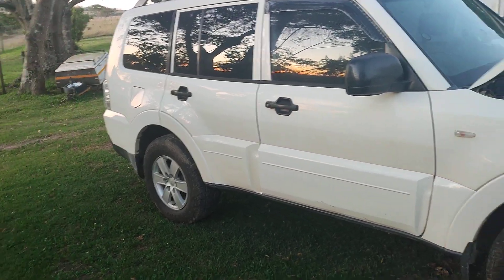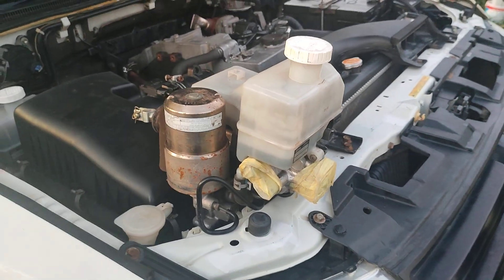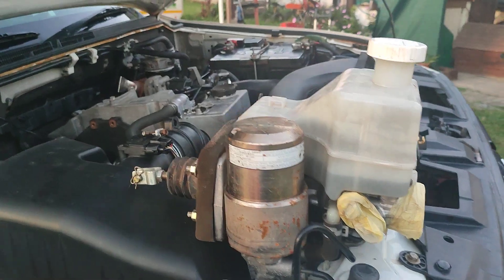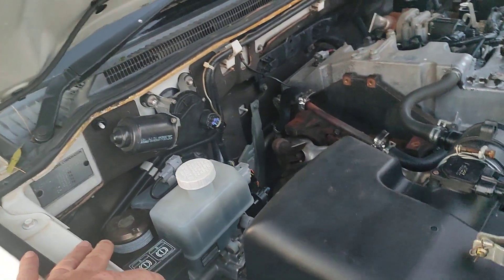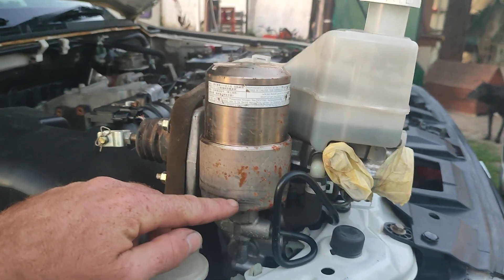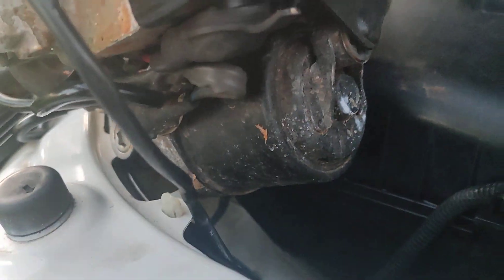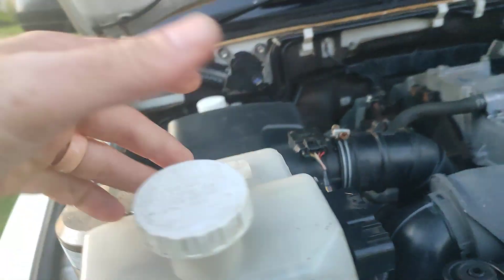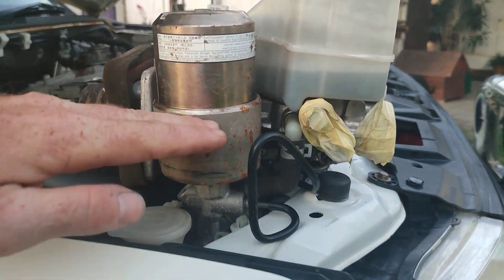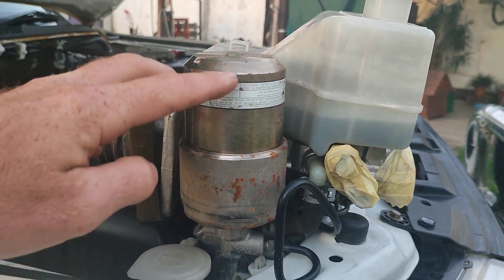With a failure of the ABS units there are quite a few failures, but generally it's the hydraulic brake booster that fails. I've got the spare here — this is the one that failed — and I've put a second-hand unit in which is working. Basically, at the bottom there's an electric motor that pumps brake fluid from the reservoir into the accumulator, starting from a piston inside.